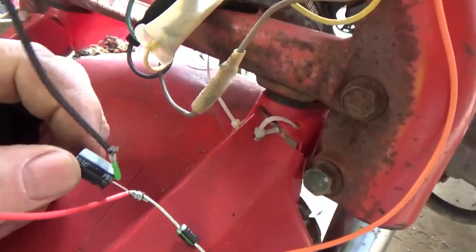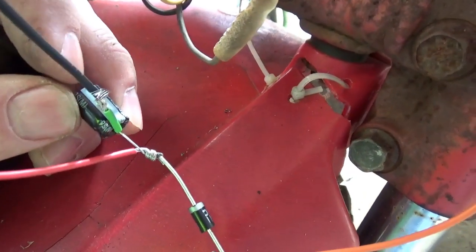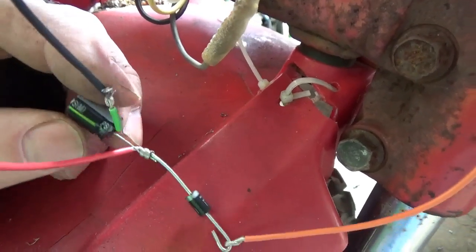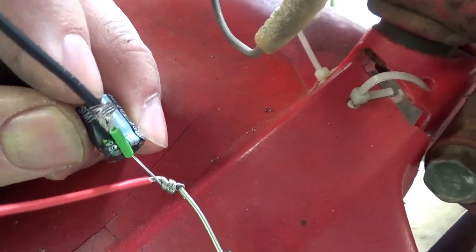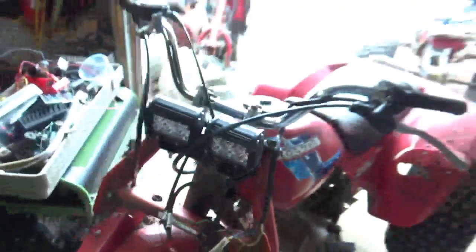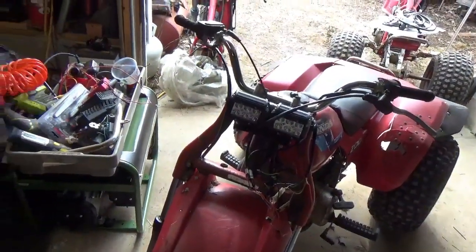The neutral goes to ground and the hot goes to the hot side of the diode and capacitor. When you're looking at these capacitors and trying to figure out which side is neutral or negative and which side is positive — the negative side of a capacitor has that white line on it. I hope you guys enjoyed me talking about it; let's see what it looks like.